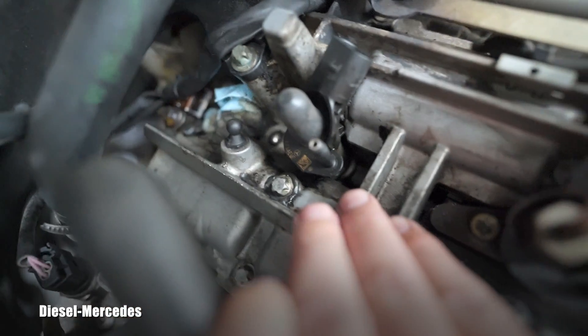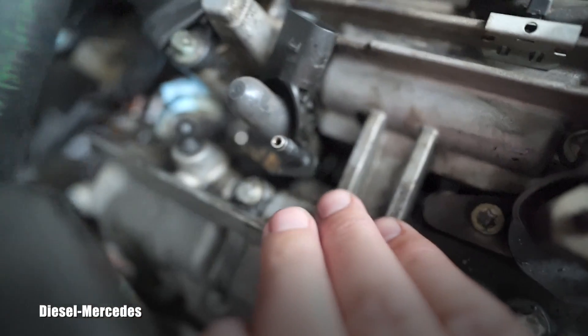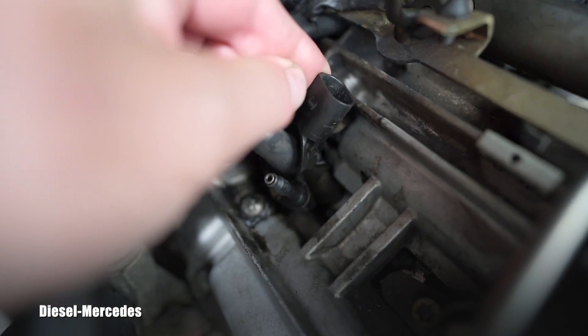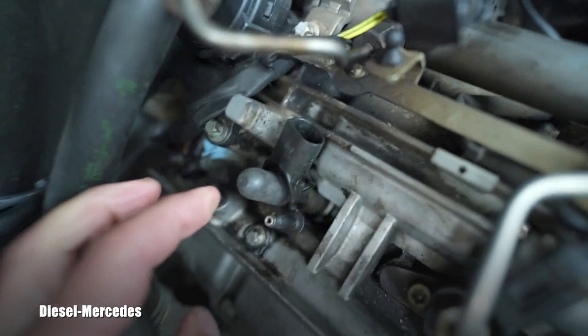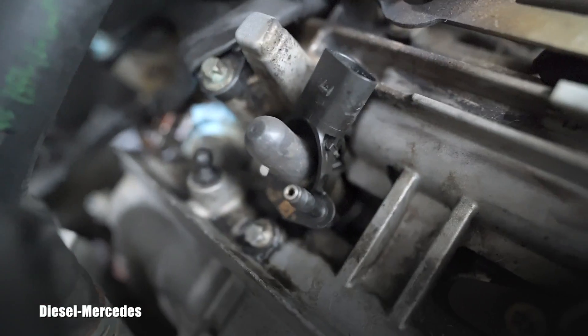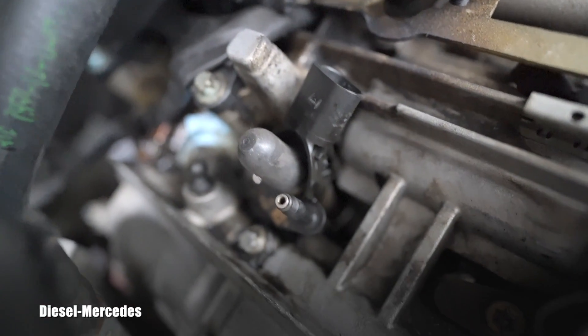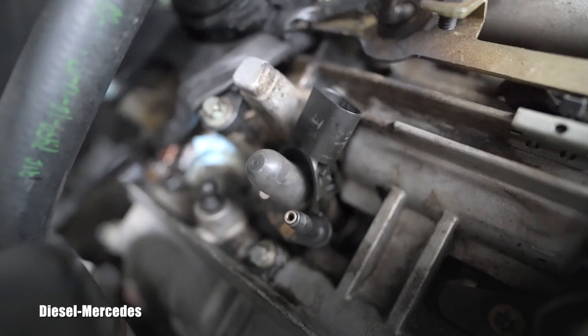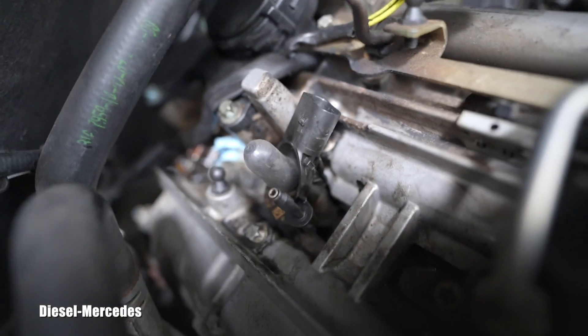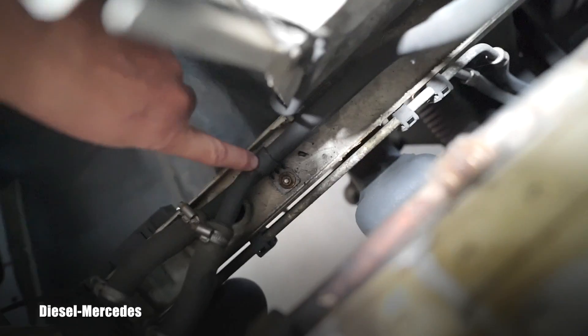Cleaning it, soaking it, repeating - but it doesn't matter. If you grab this carefully, there is absolutely no way to move that injector. This needs to be removed carefully with a puller to get to number three. I will undo this bolt and the nut on the bottom right here.